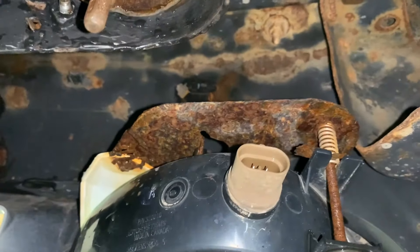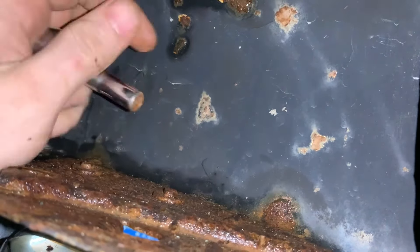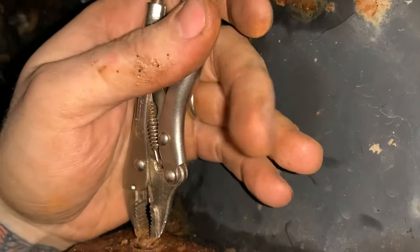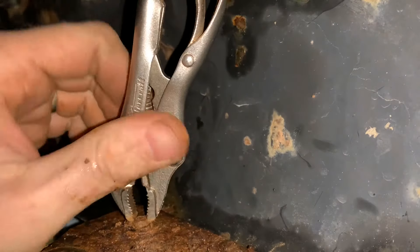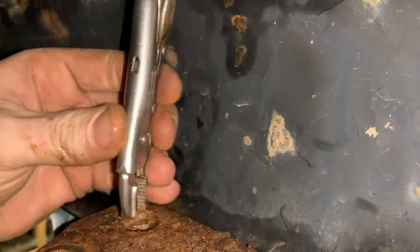There's no real clear way I can see to put the camera up here, so I'm just going to hold it and see if we can get a little shot. Here's one screw and here's the second one I need to take off — not a very easy place to see at all. Well, I ran into a little bit of an issue, but it's not too serious. I don't usually like using vice grips if I can help it, but I won't be reusing this screw — I've got body screws from the interior that are the same thing just a little bit longer. So this will work just fine.